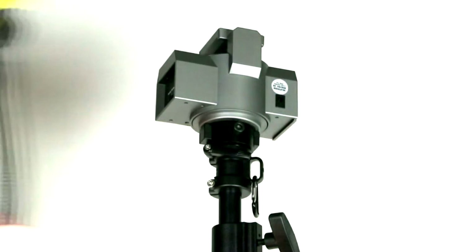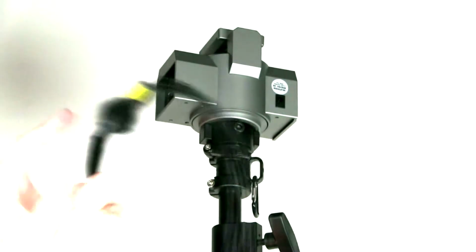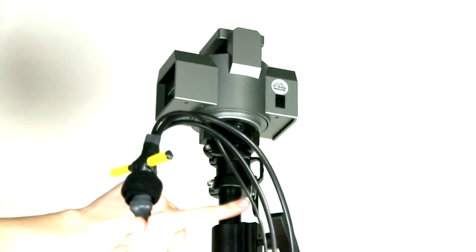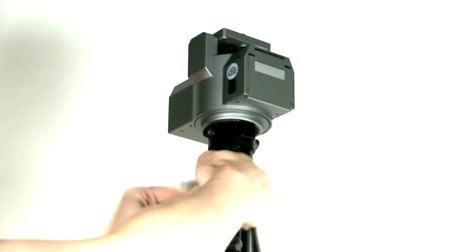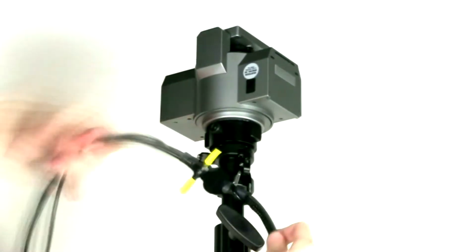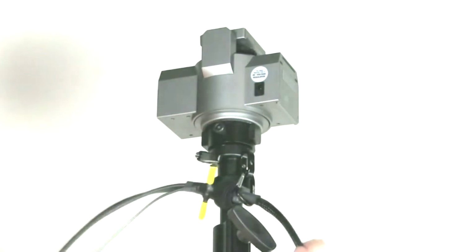Now find the cable bundle that was included with your unit and locate the yellow T-bar. This represents the top cabling. Find the space where the T-bar is and then locate the carabiner that is dangling off of a hook on the side of the top of the tubes. Use this to slide the cable bundle into the carabiner so that the T-bar is above the carabiner. This helps to dangle off the side and act as a strain relief. There's additional Velcro for you to reinforce even further.